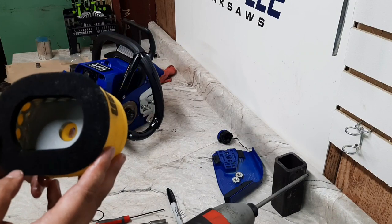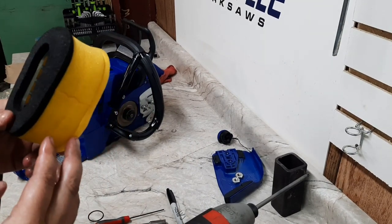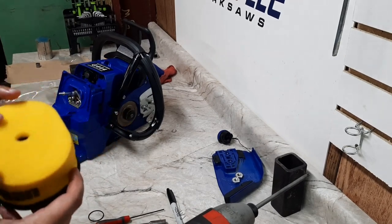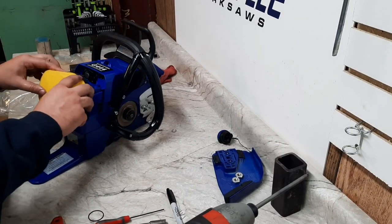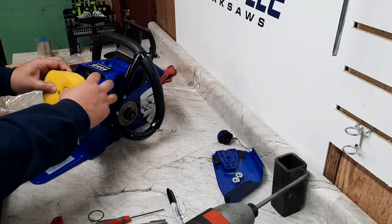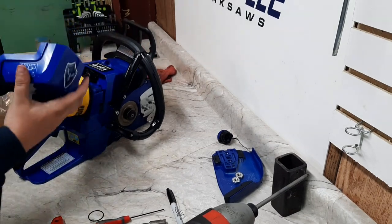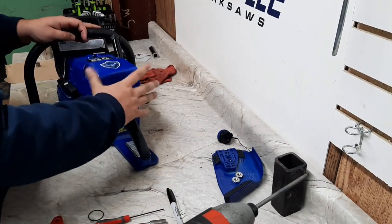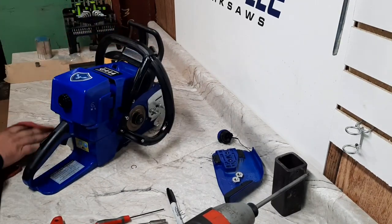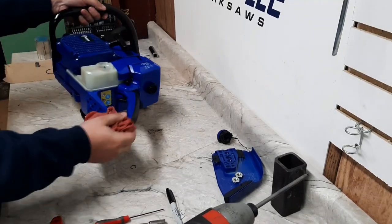Time for a muffler mod. My plan is a nice healthy muffler mod — I'll probably use one of my wide deflectors and open it right up. Here's the muffler mod — opened up nice and big under there, knocked off all the flakes. This is the filter setup from EPS Egan Performance Saws — pre-oiled Unifilter, 3D printed cage. Got to line up the front cover better once you lower your cylinder. Put those lower bolts in and it makes it a lot easier.